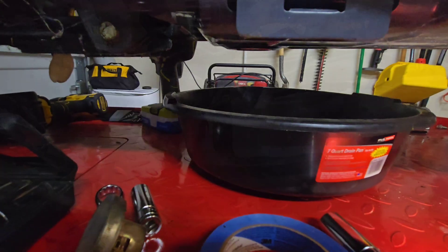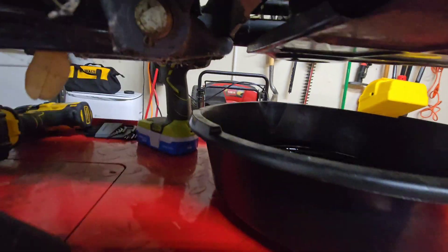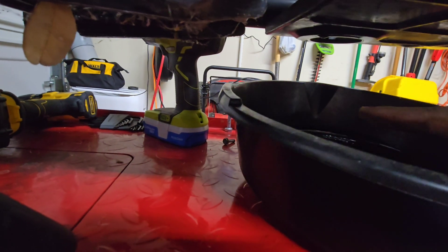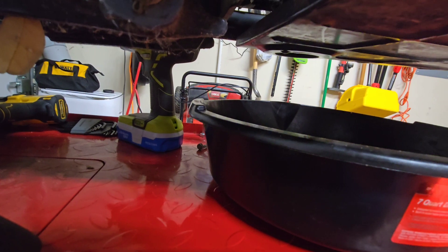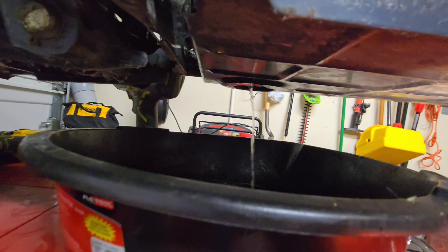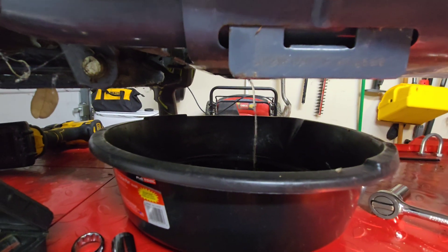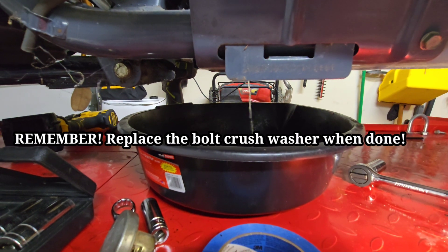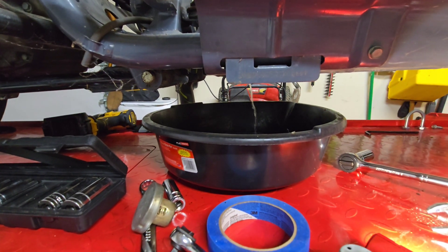Now that I have it all the way through, there you go. Just in case you're not aware, there is a drain bolt on the underside of the Helix for the gas tank. This makes it incredibly easy to winterize the bike — loosen that bolt, get all the old gas out, add some fresh gas along with a stabilizer, non-ethanol if you can find it. It just makes starting so much easier in the spring.